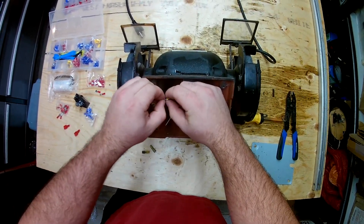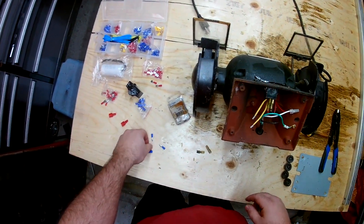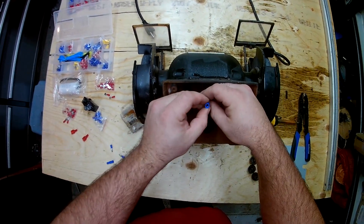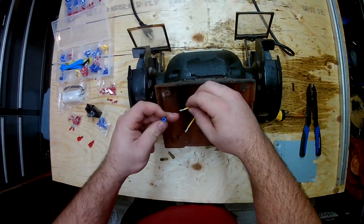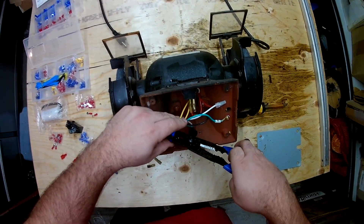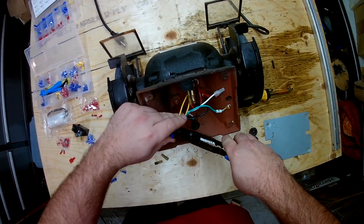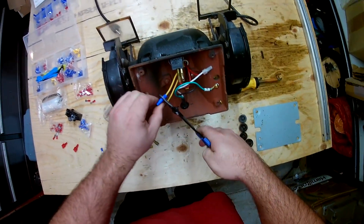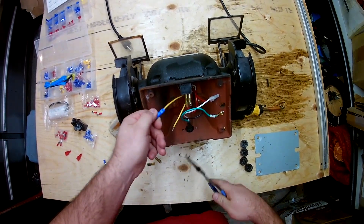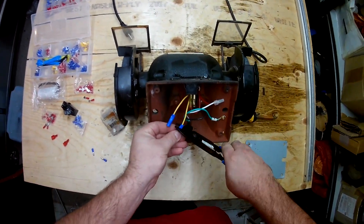That way it's the perfect length to go into the connector, and once the connector is crimped down, it'll stay in there a lot better. I couldn't do these with the red connectors because the gauge was too small — I couldn't fold it over and fit it inside. Now with the folded-over wire on the blue connectors, it's a fairly snug fit. I'll just put it in the proper slot and cinch it down real good. These ones have enough internal space that I can crimp it in two spots — it's going to stay on there real good. Just give her a little tug test to make sure it's not going to pop off on you.